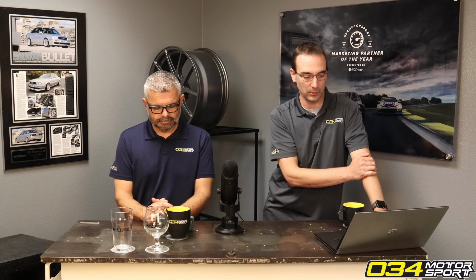Yes, and especially with the vast majority of what we're working with, where it's stock turbo or stock frame turbo size platforms, we're not really seeing any restriction on the catalysts. And on all of our stage 2 tuning, we would say that our high flow cats flow as good as test pipes for those applications, our stage 2 applications.